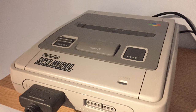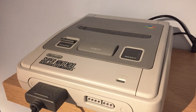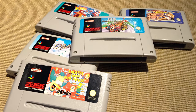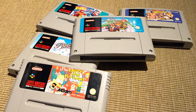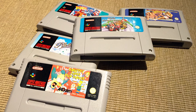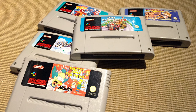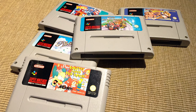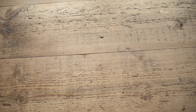I'm guessing for 90% of you this is beginner's stuff, but recently a friend of mine got his SNES out of storage after many years and he couldn't get any of the games to work. He was in a bit of a panic because he wanted to play Super Mario Kart. And what it turned out to be — and he didn't know this — was the cartridges weren't just dirty, they were filthy. Even techniques he used back in the 90s, which usually involved licking your finger and wiping it across the connector — that's a bad thing.